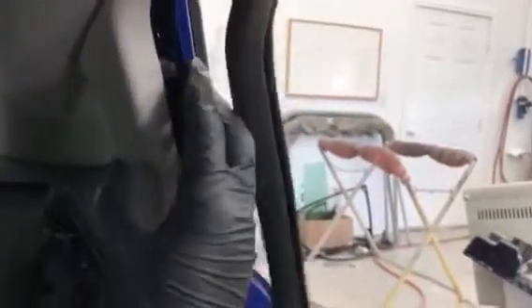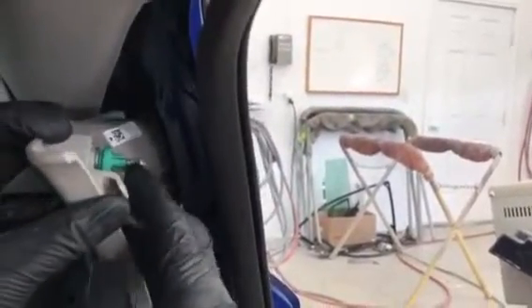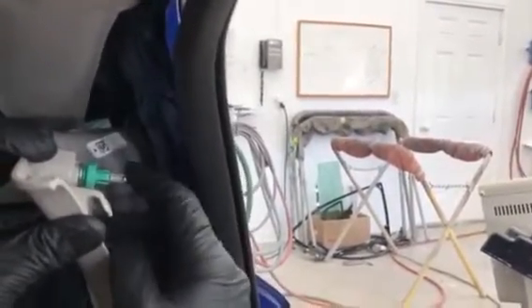Now for this next part, you're going to want to smack the top part of this trim with a rubber mallet. The reason is it's a reverse clip — this type of clip, instead of pulling out to release it, needs to be pushed in. That's to prevent it from popping out when the airbags go off. I just wrapped my rubber mallet in a towel because it leaves black marks. Just give it a smack, and this is the clip right here — it smashes in. Now you can reuse these but it's kind of tricky; I'll put a link in the description on how to reset these clips to reuse them.